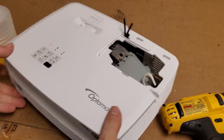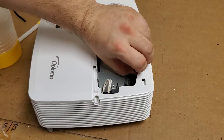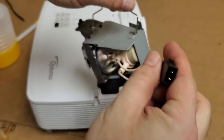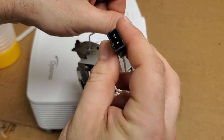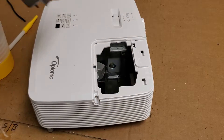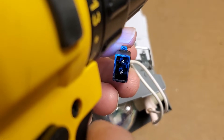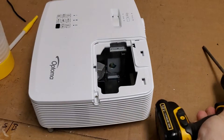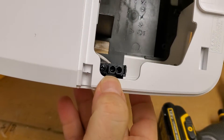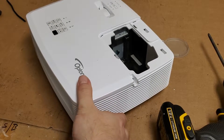It's turned off. Let's unplug it and get our little bypass out. As far as lamp problems, I suspect you didn't have the connector down all the way. There's a little notch — see that little notch there? That's going to line up with the right side of the connector. You can see that connector is keyed. So if you don't have it the right way, it won't sit down all the way and make a good connection, and then you won't have a light.